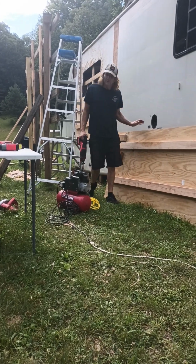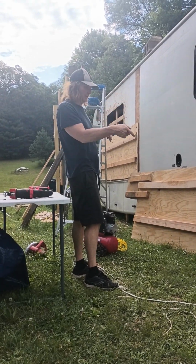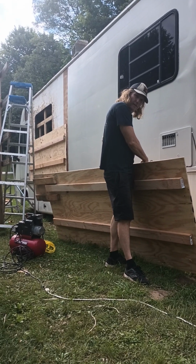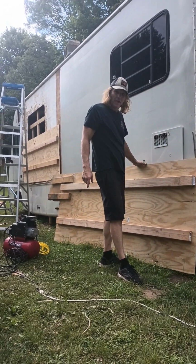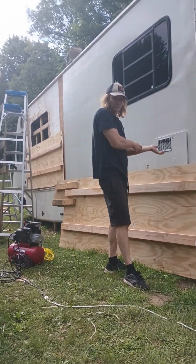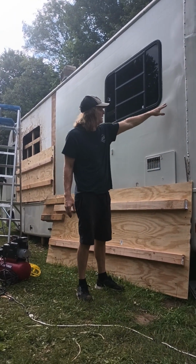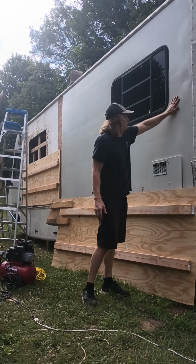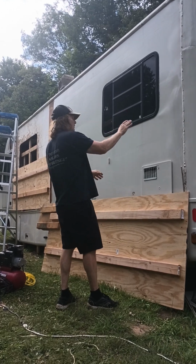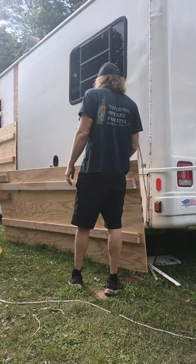Fiberglass vehicle. And we can tell people we can do either side, because all you gotta do is move these 2x4s to the other side. And then you could do the other side. You can do whatever year's Georgie Boy. You can do the delamination in the front and the back. You could make your own templates. But I'm just going to use a piece of plywood, inject that glue, and just bloop, pull this up and bloop. Injecto glue.